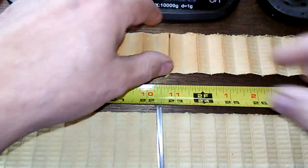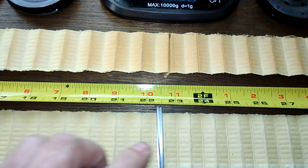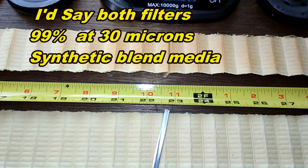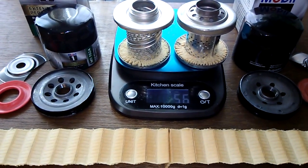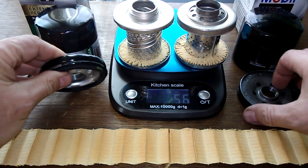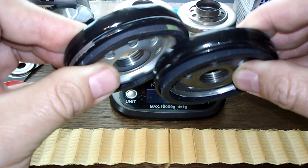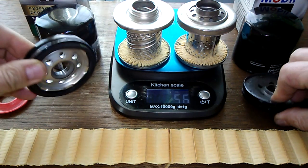Looking at the seams: the 102 has a glued inside seam, and the crimp seam on the 102A broke during cutting. Both filter medias look and feel the same — likely the same synthetic blend at 99% efficiency at 30 microns. The base plate on the newer 102A is better: it's thicker, has more holes, and the threads appear equal. It's heavier and feels beefier and better made overall.